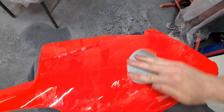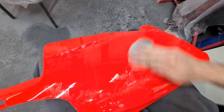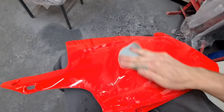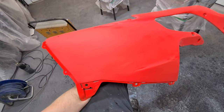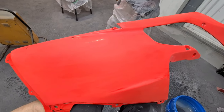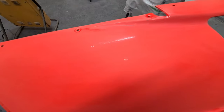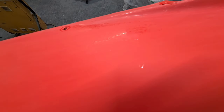I'm going to rub it over. You can actually feel the surface — you can feel the texture when you're rubbing it. If it feels slippy then you've got clear coat there. As the paper starts to grip, you know you're rubbing it down flat. I've just gone over this panel — it's not taking me long at all. I'd say about 15 to 20 minutes and already it's nice and flat. There are some dust nibs and some orange peel.